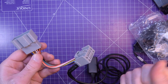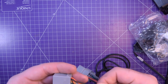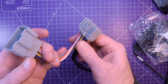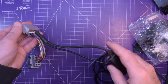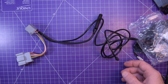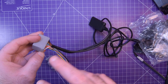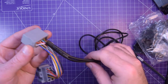This Volvo has a fantastic sound system with a fantastic amplifier, but it's old — it's from 2001. It does not have Bluetooth nor does it have auxiliary, and this should add both of them. Basically you unplug your radio, plug that connector in there, and plug this into the back of the radio, and then your car thinks it has a 6 CD changer. So this thing will act like the 6 CD changer, and then you can just plug your auxiliary in and you get that audio. You can't just plug an auxiliary into the left, right, and ground connections because you need the electronics in here to tell the radio that there is a CD changer installed.